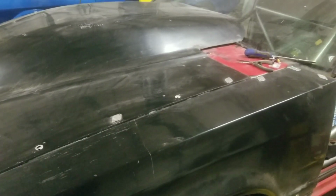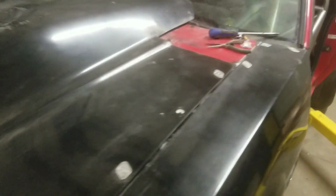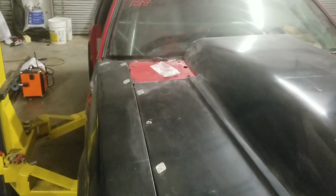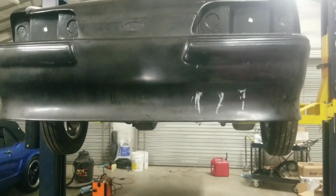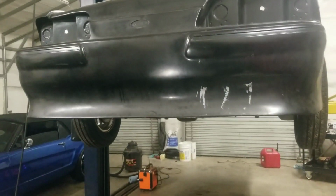But anyway, here's one we've been working on, mounting a fiberglass front end and hood on, which requires quite a bit of work actually to get this thing mounted on. You got to have some tabs added to the body of the car and build like a tree in the front end that's bonded to the inside of the front end to hold it on there. And it's quite a bit of work. Anyway, I believe this is an unlimited front end and hood.